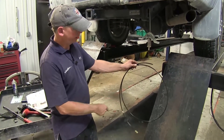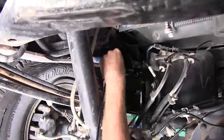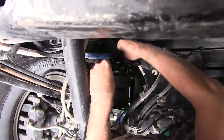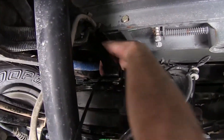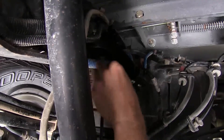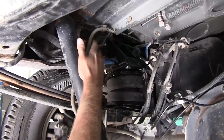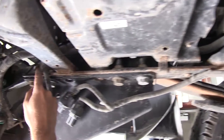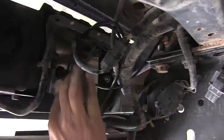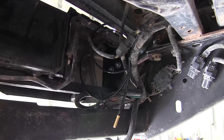Now we'll go ahead and run our airline tubing. I already have mine cut in half — I just unfolded it and cut it in half. We can use part number AL10530 from Airlift. Take our airline, run it into my fitting here, line it up until it just goes in. Make sure you have it squared up and then push it in one more time until it stops — it'll stop once and then you push it in one more time. Give it a tug to make sure it's tight. To run our airline towards the back bumper, simply follow the frame rail — use all the lines and wires back there to thread it through and hold it up and out of the way. You can have a couple of extra loops of length, which is fine in case you upgrade to a compressor system for your airbags.